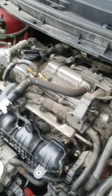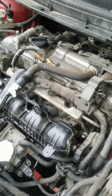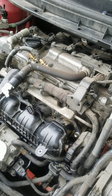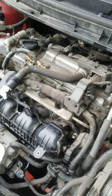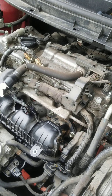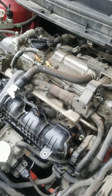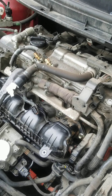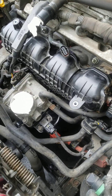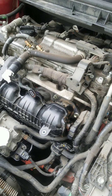I don't see any coolant going down at all, and I don't smell any coolant. I definitely smell oil and gas. Hoping it's not a volume issue or too much compression pressure on that piston, crankshaft, bearings and all. I'm guessing that blow-by - the oil maybe - though there could have been oil blowing by, but I'm seeing it's more sooty. I'm feeling a lot more confident that the oil is coming down from this location on the PCV valve.